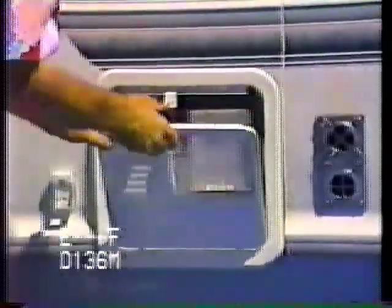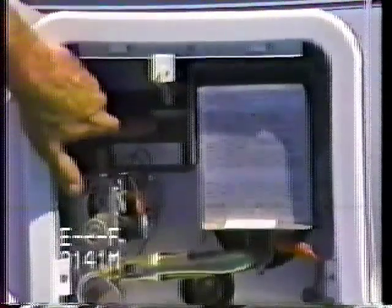Right next to it is the hot water heater. Inside is also a switch. This is an automatic igniter — you do not come out with a match and light it. The only thing inside here is a reset button, so if you do have trouble igniting it, you'll undo the little tab and open this up, pull it out, and right in here you'll see a little button that says reset. You'll push that button in and then go inside and try to reignite the hot water heater, and then you should have no problem.